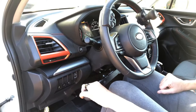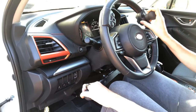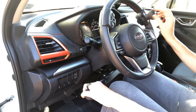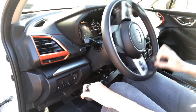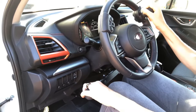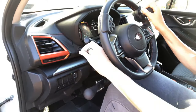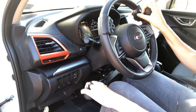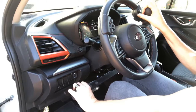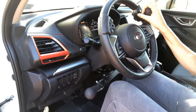While they have their left hand on the hand control, they're then taught to use the right hand and a spinner knob or some kind of steering device. This is just a standard spinner knob to help turn the wheel to the left and to the right. From this position, clients can be taught to either use the turn signal that's already in the car, or sometimes they need special equipment as well, or special buttons, so they can get to things like their turn signal, their horn, and their wipers. So this is the push, pull, left hand control.